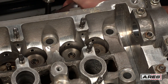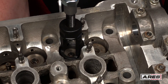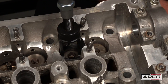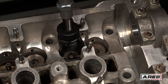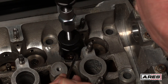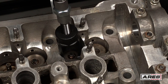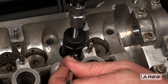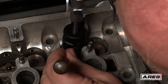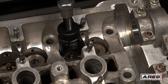I've adjusted the tool to get a little more compression on the spring. I'll line it up, make sure the foot is getting where it's supposed to go. Get this around so I can get at those keepers and compress. You can move this tool around a little bit to help break those keepers loose, and if you need to get a little screwdriver in here you can help break them loose. Then you get in with a magnet and start pulling them out one by one. Get the screwdriver in there and walk it around a little bit — and now we've got them out.